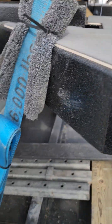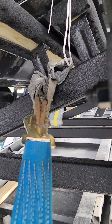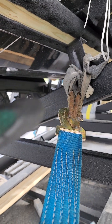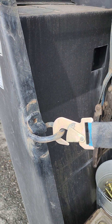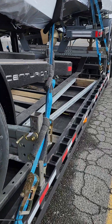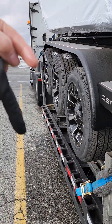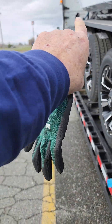These two straps are going to hold the boat, plus I have this strap. I use the O-ring straps, I go around that bar right there with carpet, and then come down. I know you don't have the D-rings there, but that's what I was talking about earlier — having the D-rings. So I have one, two, three — actually six, because the other side's the same way. Because the boat's at an angle, it's going to want to go this way, so that's why I have three pulling the boat that way.